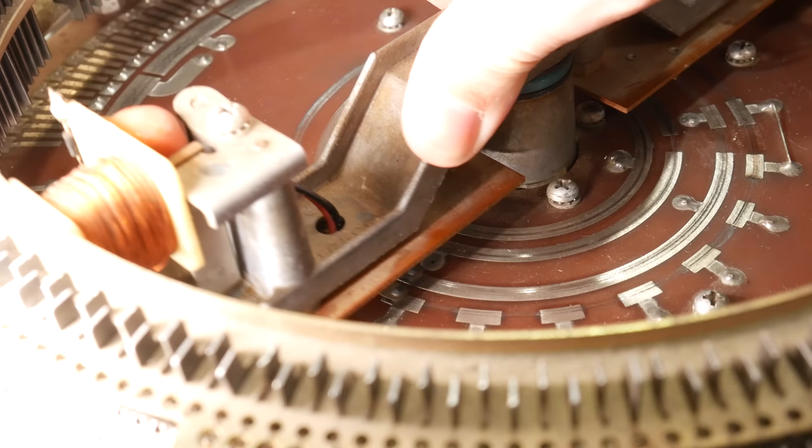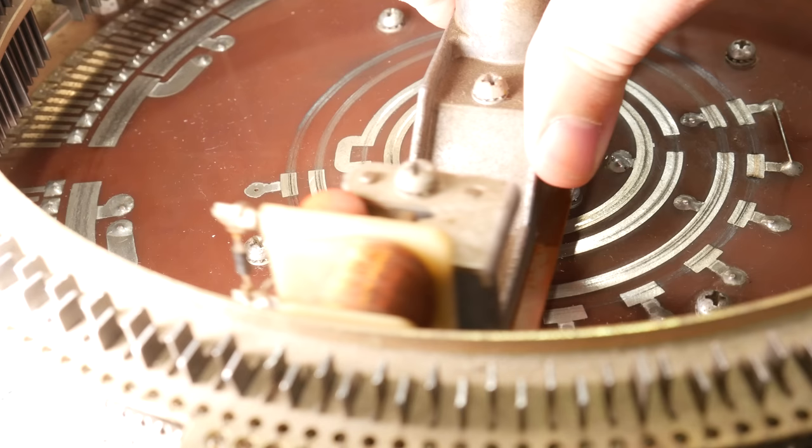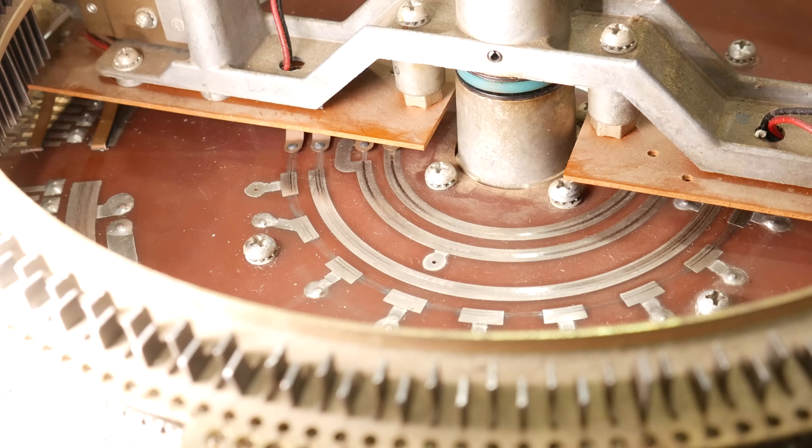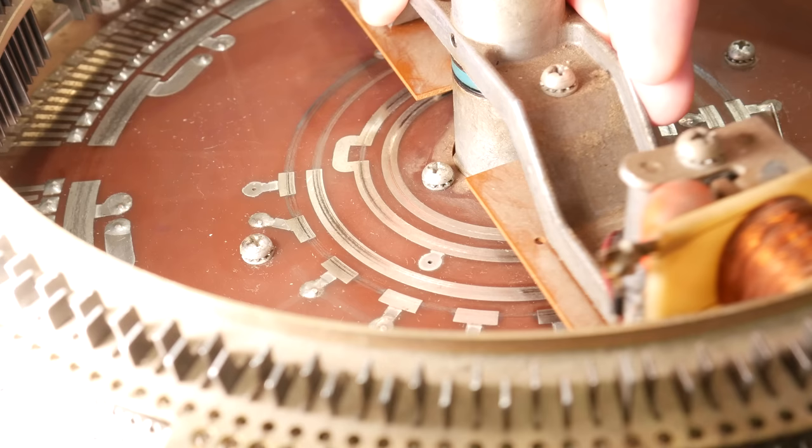So what this is really doing is sending voltage to one location, then the next, then the next, all automatically without us having to do any sort of wonky circuitry. Because remember, that's what electromechanics is. It's electrical simplicity made possible by mechanical complexity. If we want a number of different things to be activated in sequence, all we need to do is build this device, which will power itself once it moves out of a home position and makes a sweep across a number of contacts so that they get power one after the other.